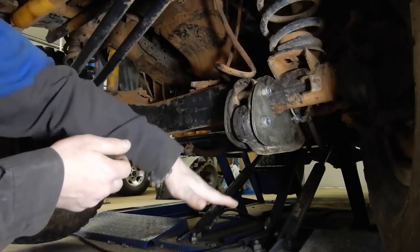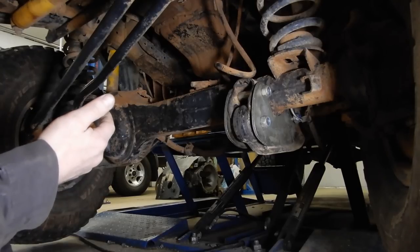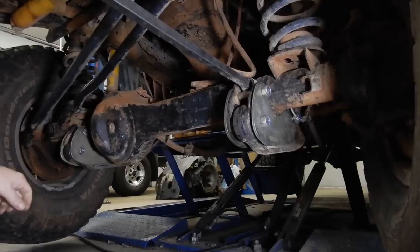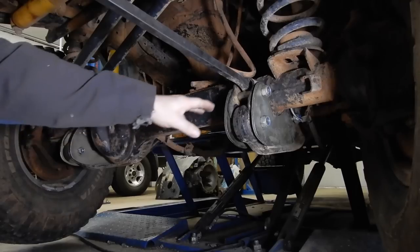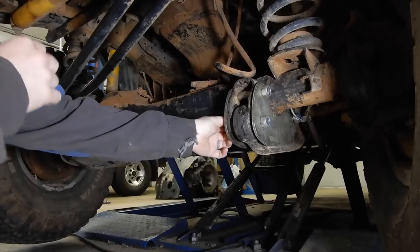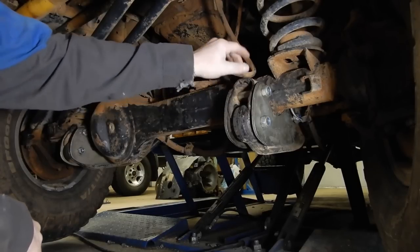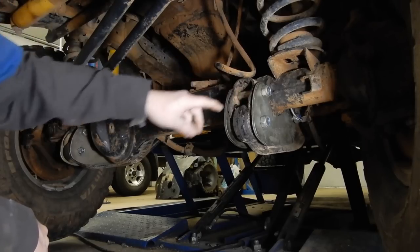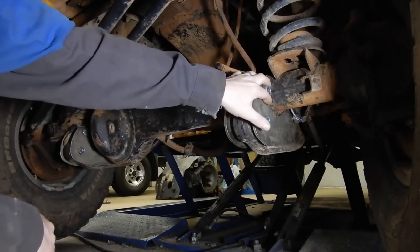With the truck on a short-rise lift, there's not enough room to swing the radius arm down in the back. So what we ended up doing is taking a long pry bar — you can stick it in right here — and either have somebody else pull up or use a floor jack, and you can pry up and get the axle to roll backwards until everything lines up. This method is kind of sketchy unless you really trust your pry bar, so it's easier to do it by removing the rear radius arm brackets, but we ended up going this route. Everything is now in and I just need to torque everything down.